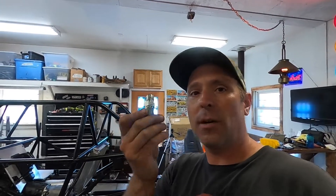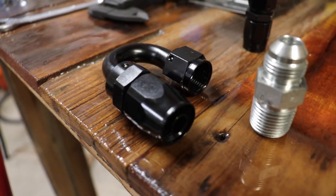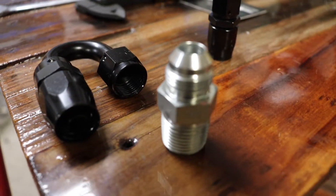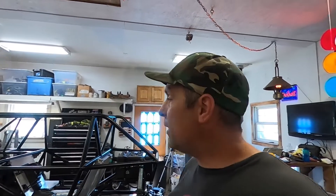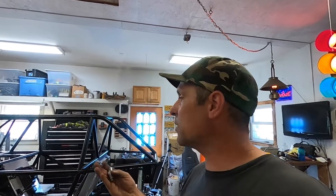I'm working on plumbing — when I say plumbing I'm talking about AN fittings. That's the expression you'll get if you go to your local parts store and ask for an AN-6 or AN-8. Unfortunately parts stores haven't gone there yet, but Summit Racing, Amazon, and those places have plenty. I use AN-3 or AN-4 for brake lines, AN-6 for transmission and fuel, and AN-8 and up for steering, except the high-pressure side on the rams which use AN-6.